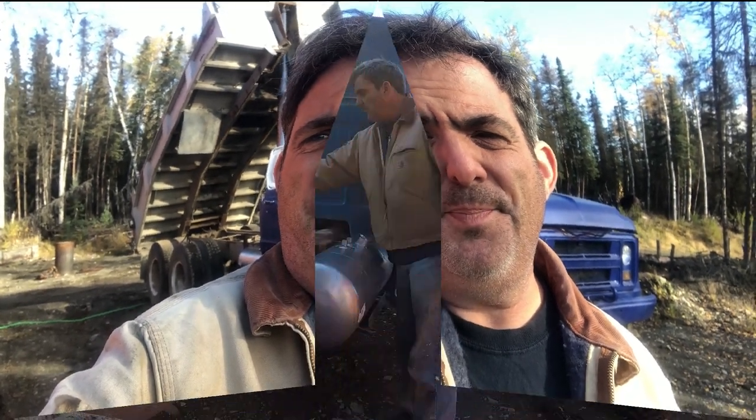Primary reason was the other fuel tank was starving when the truck was climbing hills because the fuel outlet was towards the front at the bottom. No baffling, no clunk, no nothing. I had some leftover scrap pieces laying around, so I turned them into a fuel tank, tossed them into baggage. That was fun, 48.5 pounds on the scale. Brought them up, and now it's time to install it.